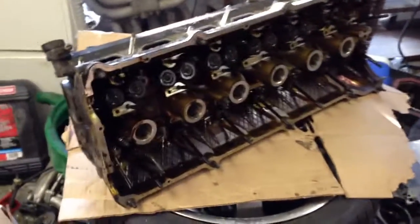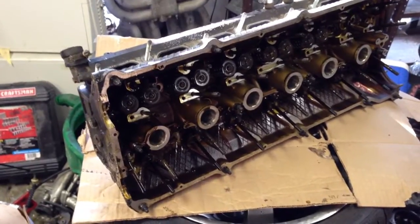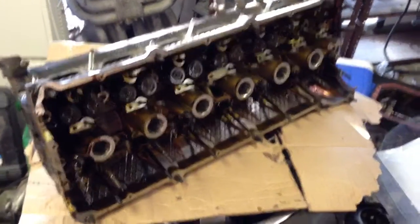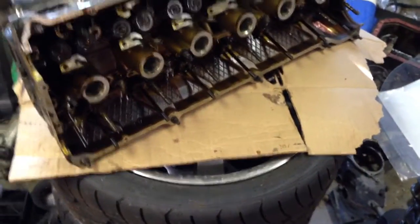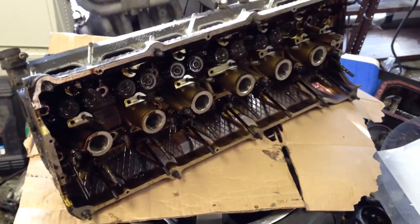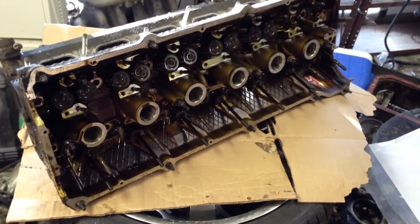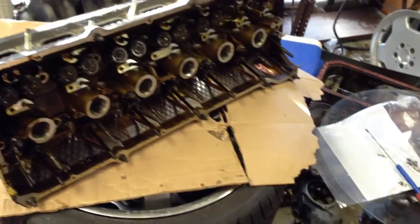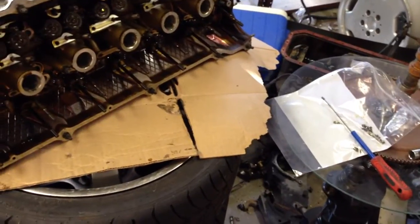Today I've got a cylinder head from a 1994 BMW 325iS. This is essentially the same casting you would see on the '91 and '92 non-Vanos cars, and it's exactly the same as all M50TU, M52 non-TU, the single Vanos TU, the S52, and the S50B30US.